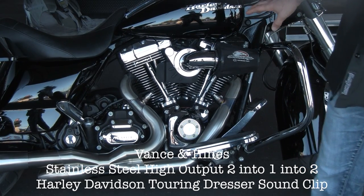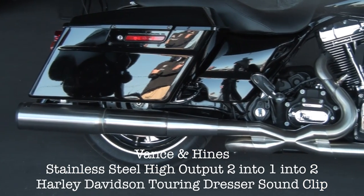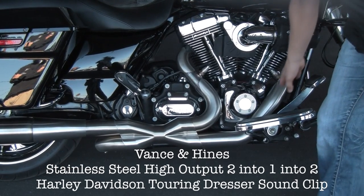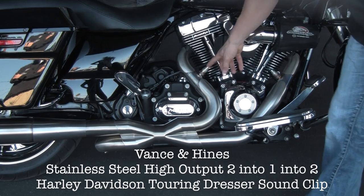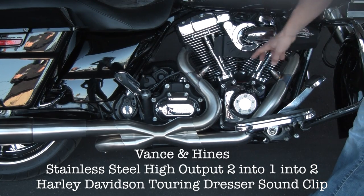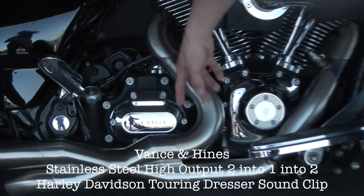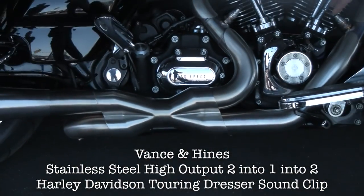And why do we have this motor configuration on this? It's a beautiful exhaust system, all made of aircraft quality stainless steel, with heat shields on all the critical areas. It has dual O2 sensor bungs — 18mm O2s on the outside to really offer you the tuning capabilities, as well as 12mm O2 sensors on the backside to give you adaptability.